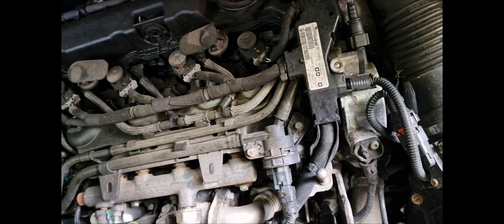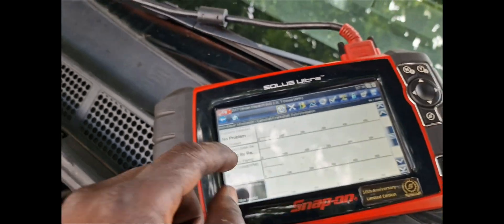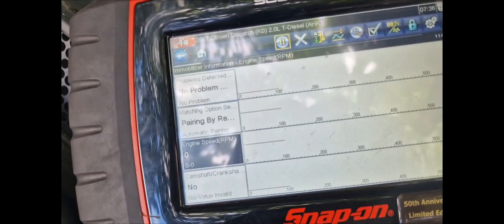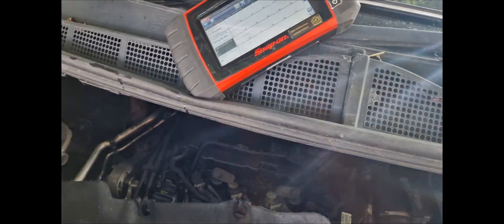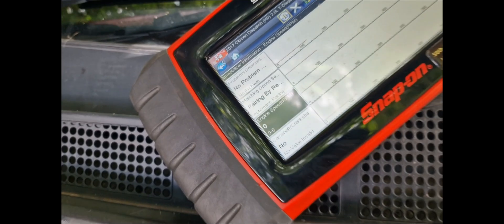I'm not too sure on the engine size, but here is the starter motor relay. What I'm trying to see is why it's not starting — I want to see if I'm getting engine RPM, and if I've got crankshaft and camshaft synchronization. I'm just gonna push that in and look. It looks like a timing belt on this engine has snapped. I think we're gonna have a timing belt issue, but there's no RPM and no synchronization when the engine is turning over.